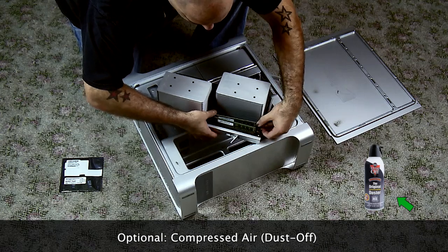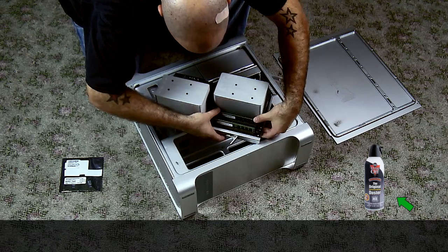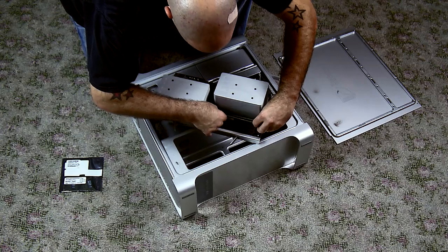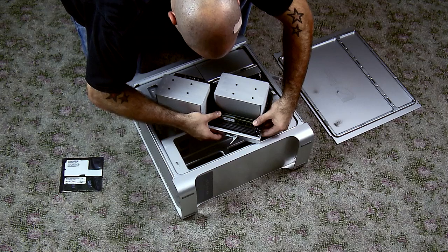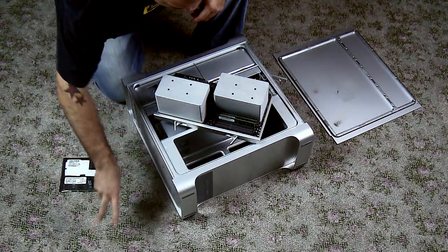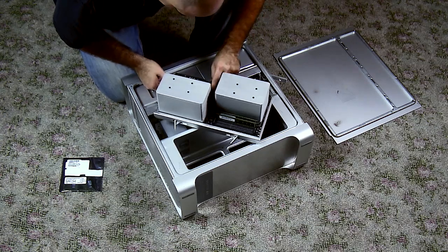The first thing I did was loosen all the memory slots because I was going to move the 2 gigabyte RAM chips into the back slots so it addresses the 16 gigs before it hits these 8 gigs. The 16 gigabyte upgrade kit is a set of four 4 gigabyte chips. My Mac Pro came with four 2 gigabyte chips. Once this install is complete I should have 24 gigabytes of RAM.